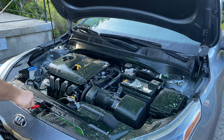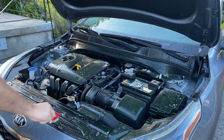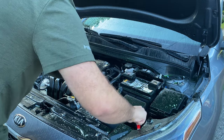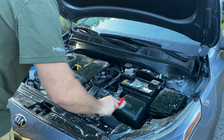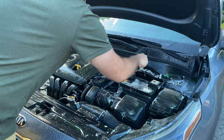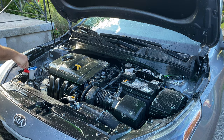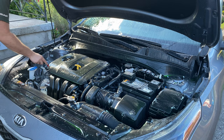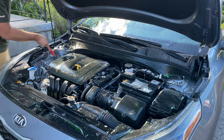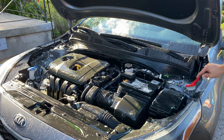Then I used one of my detailing brushes to go ahead and agitate most of the surfaces that I can. Of course using a bigger brush would probably be a lot more efficient, however I didn't have that handy, so I just used a small one. Go ahead and agitate all the surfaces where you can find dust, grease, maybe buildup. Be very careful around all the connectors and rubber hoses — just something to be careful around — however the rest of the engine bay is fair game. I'll go ahead and fast forward this for you because it is kind of a time-consuming process.